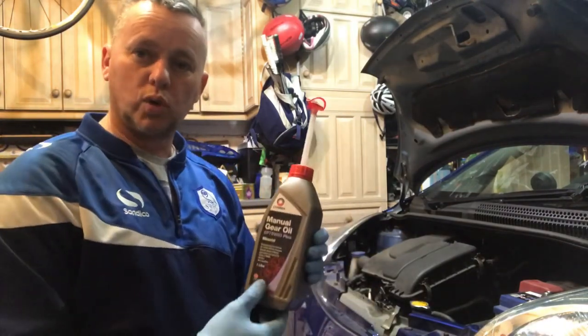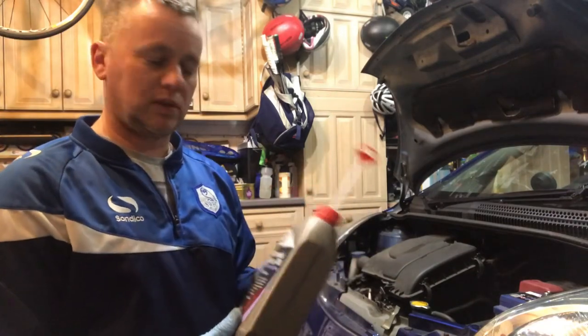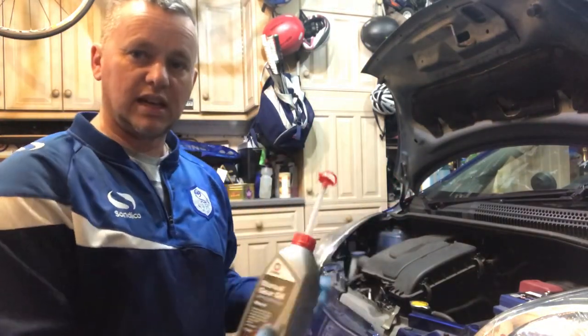I've got my pump tool, so I'm going to use that. I'm just going to suck it out of the bottle and pump it straight in with that. It's a tricky one though. It's quite hard to get it in the hole. Right, there she is. Yes, perfect. Look at that. Like I say, 1.7, and it's there. Hallelujah. Great news. Then we've got the 24mm bung just to pop back in the hole. There we go. Whew. Gearbox oil changed. So there we go. C1 clutch all finished.